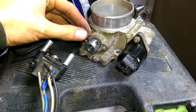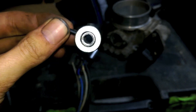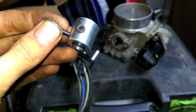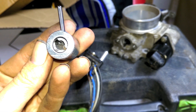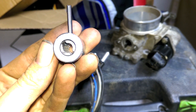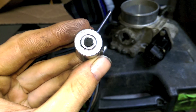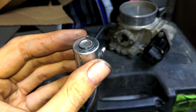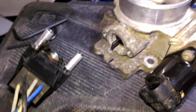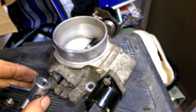Here's the finished product — inner and outer bushing together, set screw, roll pin. I had to give the inner part two wraps of electrical tape to take up the gap so it was sitting centered. I also gave the inner one a little chamfer so it rides on that screw better, because at first there was too much tension and the throttle body wasn't snapping closed properly.